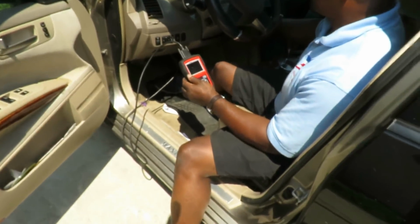Be right back. Alright guys and girls, there you have it. There's the end of this 3-part series. Put that intake on. Our short-term fuel trims dropped well below what it was before. Still a little high, I'm a little uncomfortable with the high side on bank 2, but it could be a lot of things at 200,000 miles. But as long as that light don't come back on, everything's good, I'm content with it.